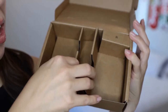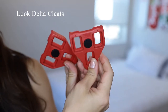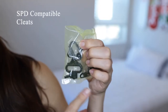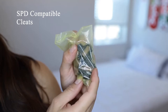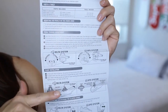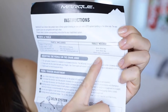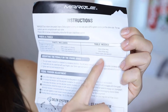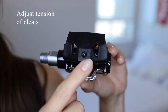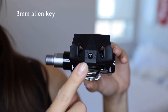Underneath the pedals in the packaging are the remainder parts. First up we have a pair of Look Delta cleats and the corresponding screws, as well as the SPD compatible cleats. There's an instruction card with notes on the front and assembly instructions on the back, plus a breakdown of all the parts included. You'll need a 4mm Allen key, a 3mm Allen key, and a 15mm open end wrench. You can also adjust the tension of your cleats using a 3mm Allen key — just rotate it either left or right to increase or decrease the tension.